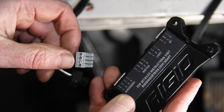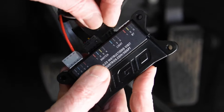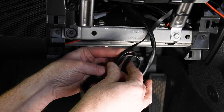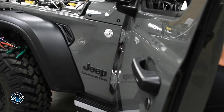For the control module wiring, we only needed the red wire on the accessory plug. We then plugged in the control pad plug, and lastly the black and white wire to the light bar plug. We then coiled up the excess control pad wiring and zip-tied the control module to the support plate under the steering column.